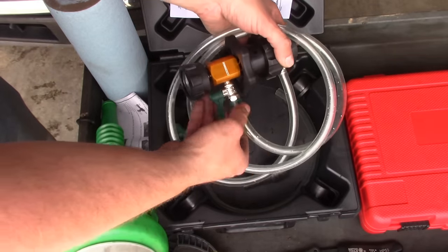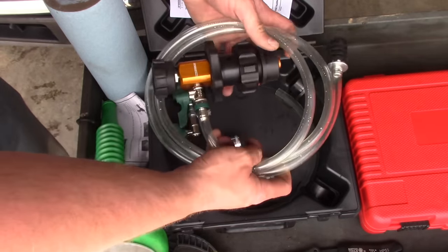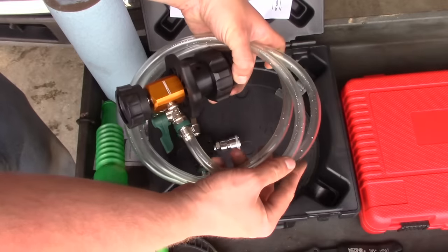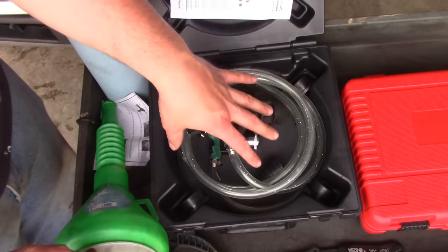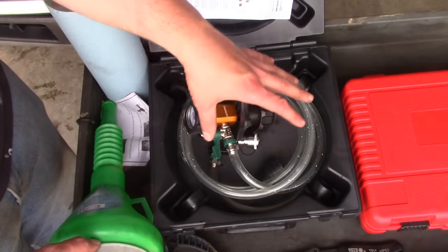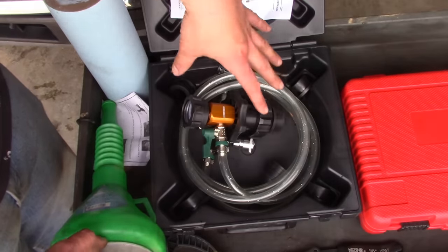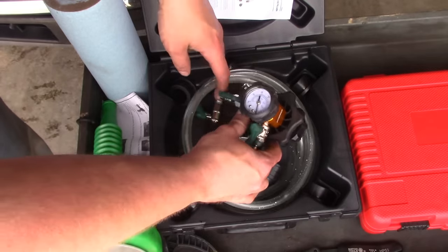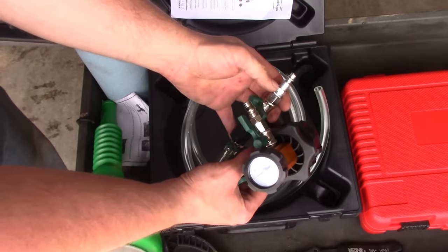What I'll probably do in the future is pop out this fitting and put a quick disconnect on it so I can make up different hoses — a longer fill hose for tall vehicles, and hoses for different fluids. It would be nice to use this for power steering fluid or even brake fluid in certain applications, like clutches with a remote-mount master cylinder. Build quality overall is pretty good. The only issues I've had are the supplied air fitting and the gauge housing being a bit loose, but neither affects how it works.